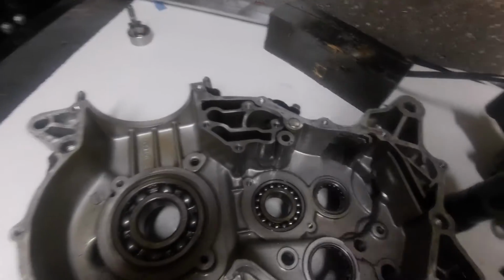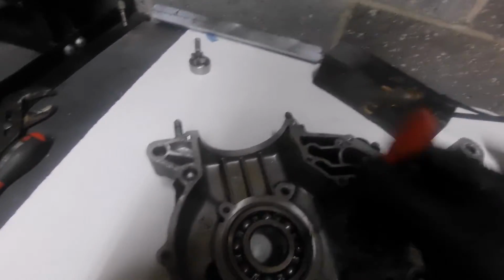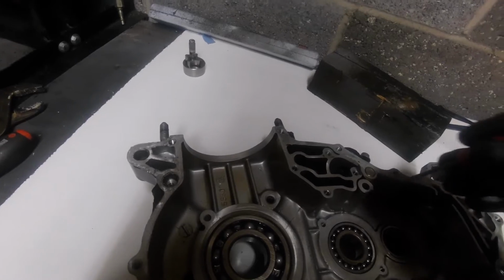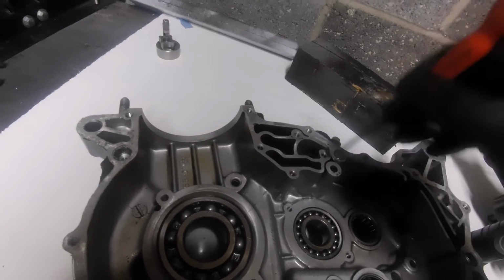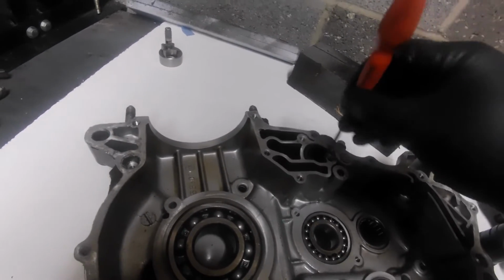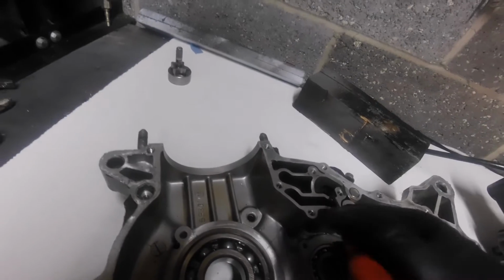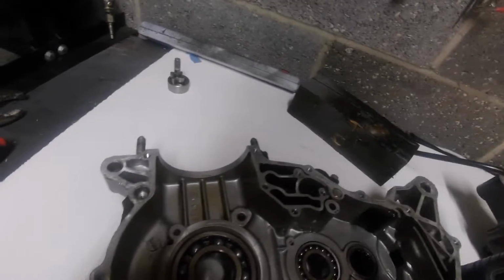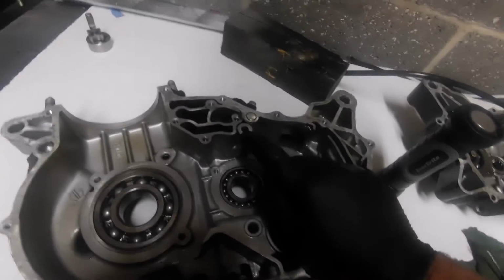But what if we bleed too much pressure off there and none goes up to feed the oil pressure pump, to feed the big end and the... How do we know that by chopping a section of case off there, we're, I mean, are we sending 95% of whatever this scavenge pump has produced out of this bleed off hole? Essentially that's all it is, and a little bit up here to feed the oil pressure pump. How do we know quantities? That's my only concern personally here.